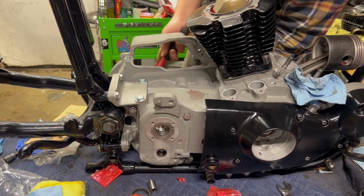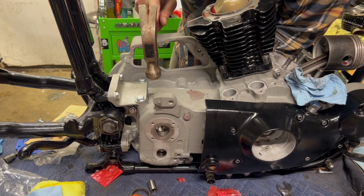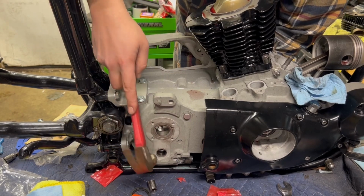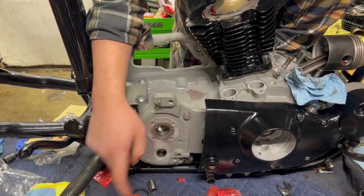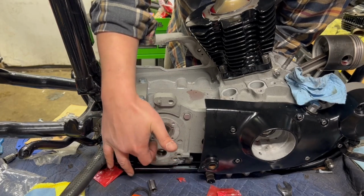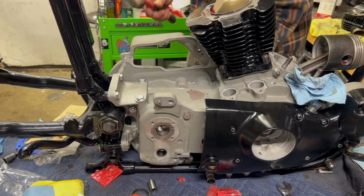Again, I would recommend doing this before you disassemble, blast, and coat the cases. I think, now in retrospect, hindsight's 20/20, right? What I did, I pounded that outer cage out because I wanted to keep this race in the case so I could blast it and not worry about it. We're past that. This race has to come out, then we'll pound the new bearing in.